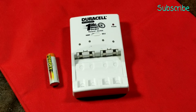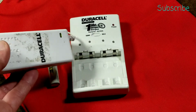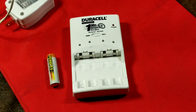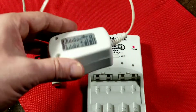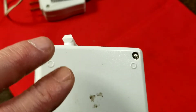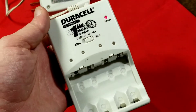They always came with these kind of oddball power bricks. I discovered that Duracell had a larger brick as well — this is the original 1.7-amp brick, and there's also a larger 2.5-amp brick. I'm not sure what charger that came with, but it's compatible with this thing and seems to work a lot better. The little charger brick it comes with always seems to get pretty hot. Also worth mentioning, they use split-tip security screws — just two prongs — which do come with most security quarter-inch bit sets, though it's a little odd that Duracell put those on there.